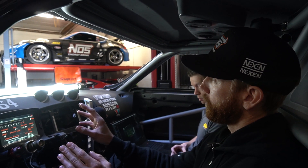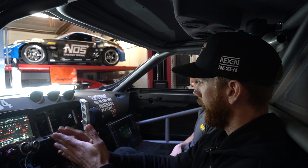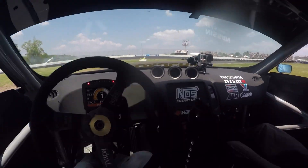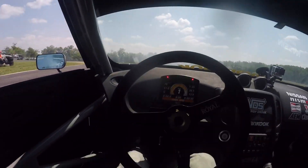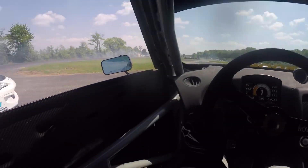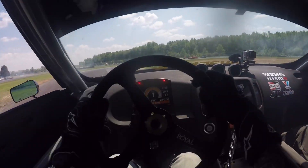Can you have it be variable within a window, or is it just a high and low number? For example, our oil pressure will dip down sometimes — like when you clutch, run up on a turn, or clutch in. A car might almost stall, drops down to like 10 psi, but it comes right back up. At 500 RPM it's not a problem. But if we see 10 psi at 6000 RPM, that's when you want the big warning light to come on.